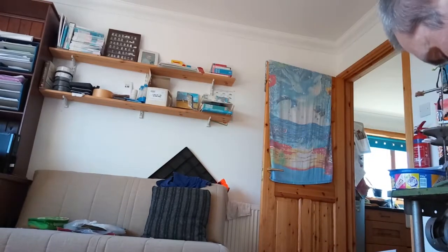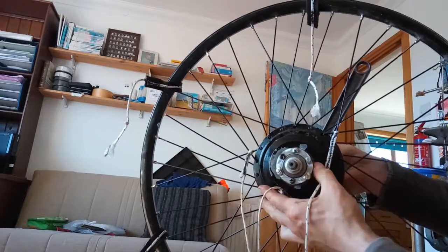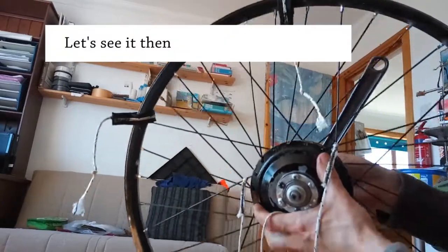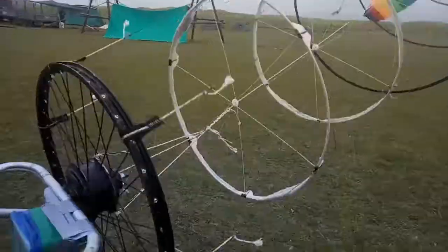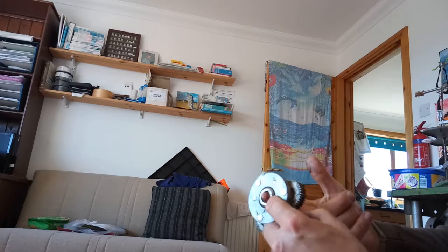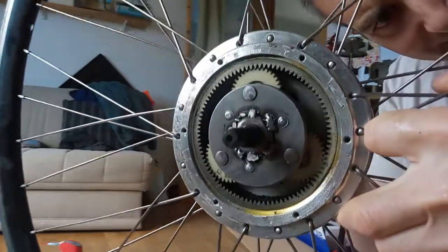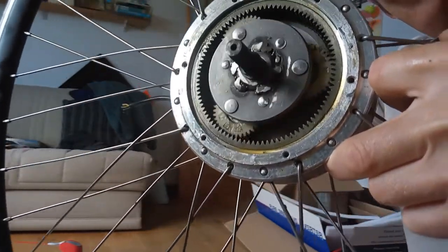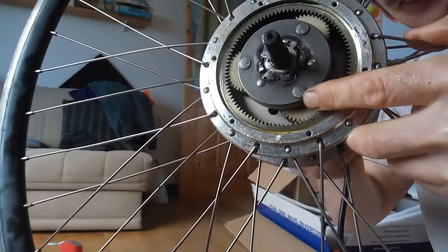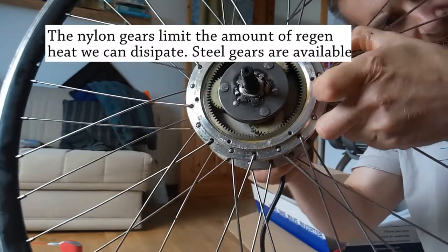The first one that I bodged - well, still works, I call it a bodge - but if I hold this here, it's the same both ways, because I gave it a really nasty piece of welding in there. I've also put a thrust bearing on the front on the axle to hold the motor in place, and I think that helps a lot. It's a very thin piece of case, so welding that on there - there's all this grease, it'll have to be cleaned up before you can weld, because it's going to get awfully hot. Now that I've welded the planetary gear so that it's shut, you see the metal ring between these gears - as I turn the shaft, that's turning both ways, being driven backwards as well as forwards. So we should be able to get regen out of there.